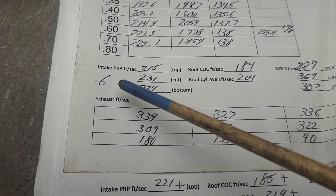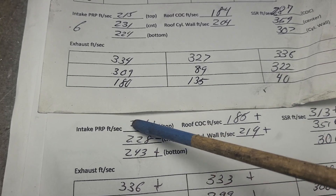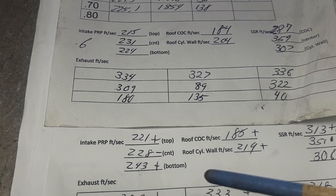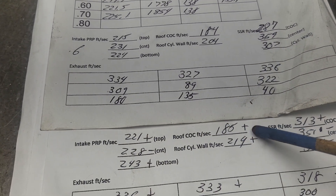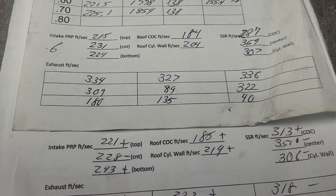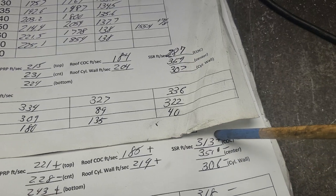Let's go through our airspeeds — all of these are taken at 600. This is what our pinch was, this is what our pinch is now. We got plus, minus, plus — not a huge change even though the pinch is a little bit bigger here because I cleaned it up. I didn't take a ton of metal out because there's not a lot of metal to take out; it's kind of as big as they can make that style to begin with. On the roof: plus, plus — very tiny plus, but a plus. A little more speed on the cylinder wall side, probably because that huge sharp edge isn't there. Short side radius: plus, minus, minus — but we are a lot more even than we were.